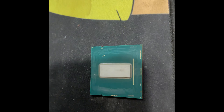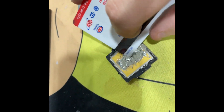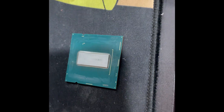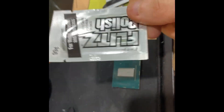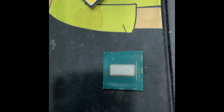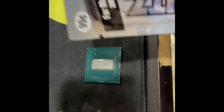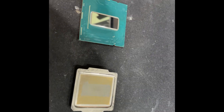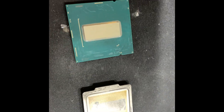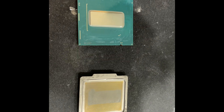All clean. I'm doing the IHS over here too. It's kind of goopy and you can see it eating away at the solder. The next step is to use this stuff to get rid of the solder residue on the die — it'll make it a mirror finish, polish it all up really nicely. And there we go. Perfect D-lid all around. Now let's go throw it in the rig and see if it performs better than that tech cooler.